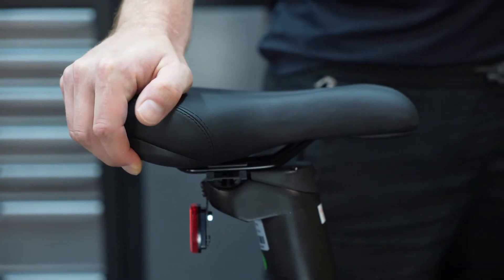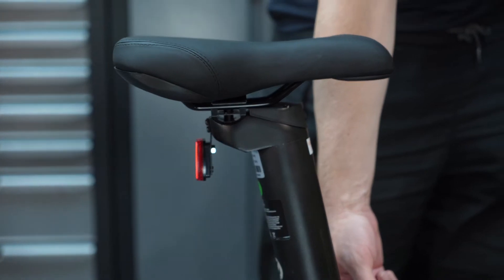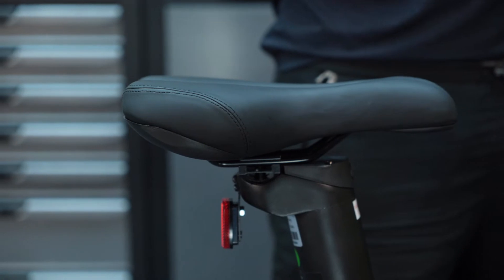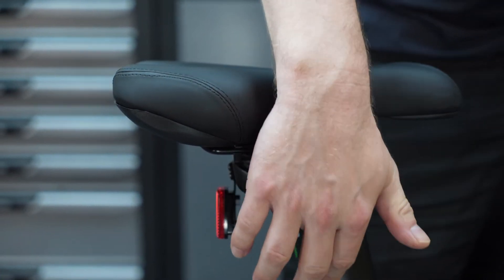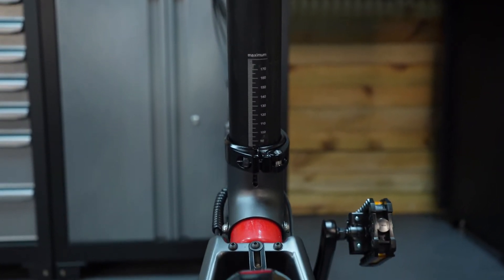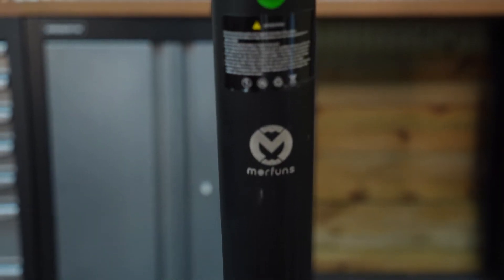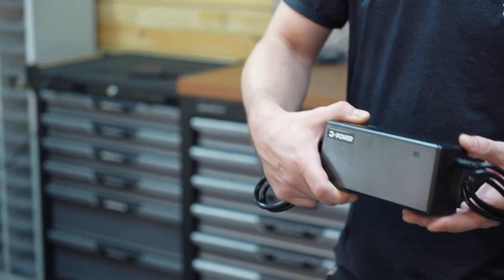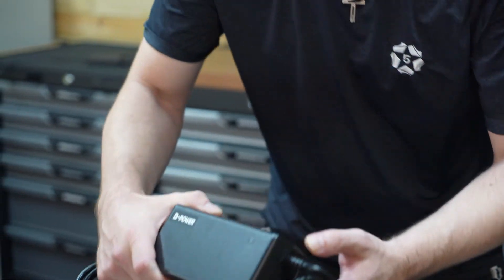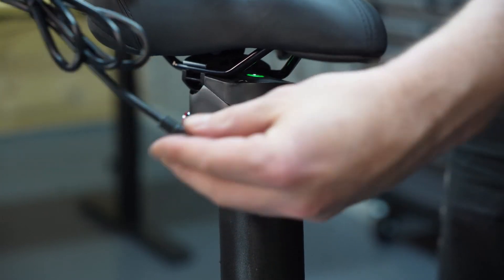The saddle is the Zeus comfort model — both soft and comfortable. The seat tube is 57mm of 6061 aluminium alloy and also houses the battery, so it can be taken with you to prevent theft and recharged at the same time. Packed inside are 30 21700 battery cells, giving you 36V and 15Ah. The system uses 36V to generate 10A for a cruising range of over 80km. The charger is a 100–240V smart charger that works from home sockets around the world, feeding 42V to fully charge an empty battery in about 4–6 hours.